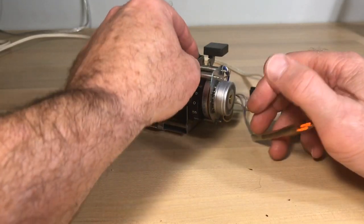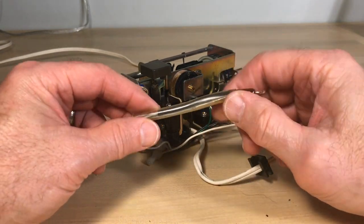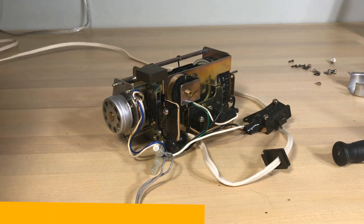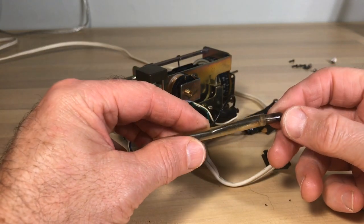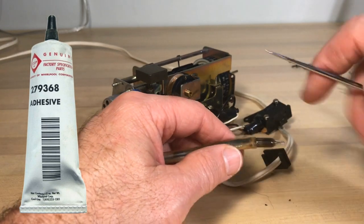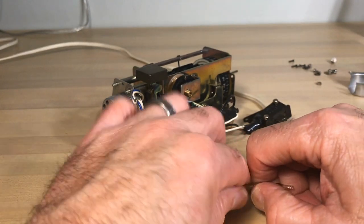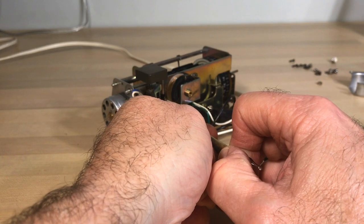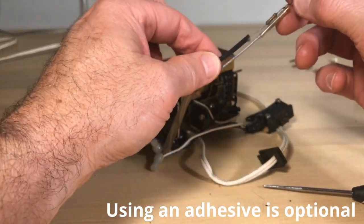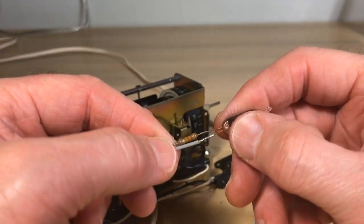Turning our attention to this bulb: the components are in good shape and we seem to have enough wire to work with. Sometimes I'll rebuild a whole component, but this time I'm going to show you how to replace just the bulb. Instead of undoing all these nuts, we're going to try to preserve everything like it was originally. They use a brown adhesive — you're going to have to break this loose with something like a pick. The silicone adhesive I use is Whirlpool part 297368, for putting felt on dryers. It's waterproof and high temperature, so it's perfect, and you do not have to overdo it. It's like rubber cement but high temperature — you're not going to have to worry about something flaming up.